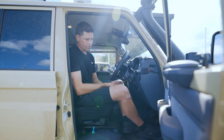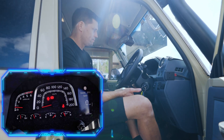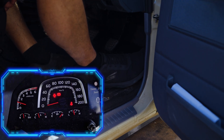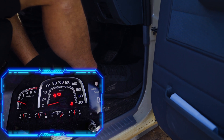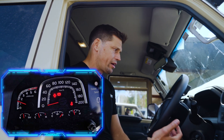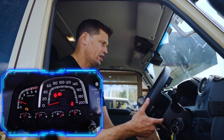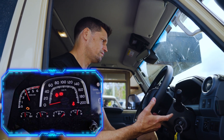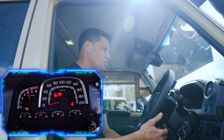I'm just going to show you how this works. At the moment I'm going to hold my foot at 1,500 RPM, and you can see that I'm not touching anything more than my pedal — it stays there, exactly the same. Now I'm going to pull in my cruise control stalk and get it into programming mode for the pedal sensitivity. We're on the lowest setting — I'm just going to click it up to the next one, next one, next one, and you can see there all the way up to the maximum setting. You can see the difference; I'm not touching anything to do with my pedal, but the sensitivity has changed. What the ECU is seeing is a higher number, and that is how you get the car to feel a lot different when you are driving.